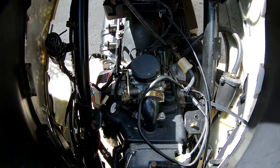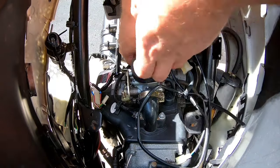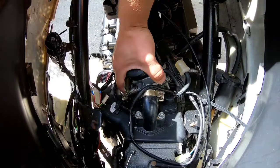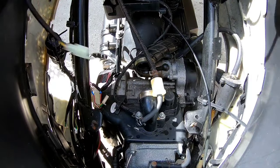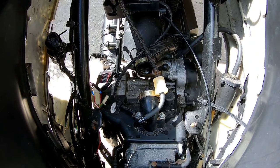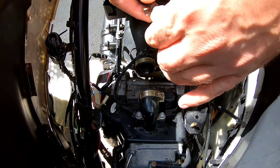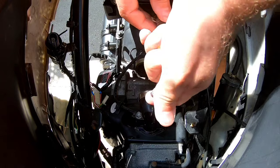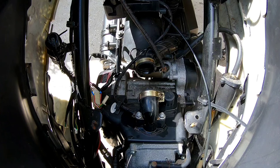You don't have to worry about leaks. Now we're just going to pop it on off of there — start with the air filter. Air filter's off. Now we're going to grab the carb — this might take a little bit of work — and it just pops right out. I'm going to keep the old one for parts and set it aside. Then we'll disconnect this remaining fuel line — it's actually going to leak a bit once disconnected, so I'll put my finger over it.